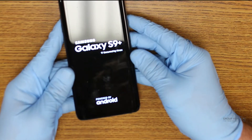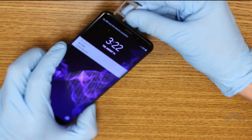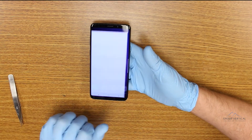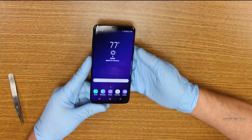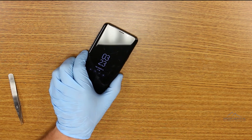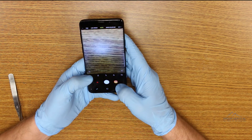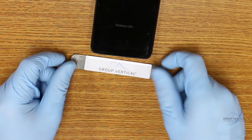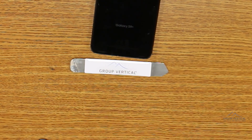The S9 Plus isn't so different from the S9, or the other Galaxy phones at all really. If your hand suddenly grew 7% between working on an S9 and S9 Plus, you might not even notice the difference, but we did find more adhesive holding down the back glass, which made the process a tad more nerve-wracking than normal. Keep that in mind, along with that squirrely fingerprint sensor cable, and you'll do fine opening this phone. We hope you enjoyed this video — please let us know in the comments and subscribe to our channel. You can find replacement parts for the S9 Plus and other phones and tablets on our website at groupvertical.com. Check the video description for links on commonly repaired parts. Thanks for watching.